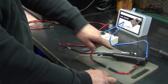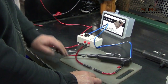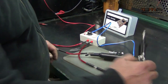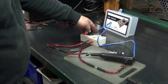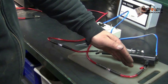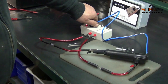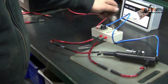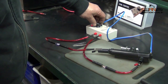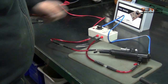So while we're still set up, I thought I'd better just try this coil with these two leads. These two leads have got about an inch and a quarter gap, and it didn't work on the old coil. It didn't have enough spark to jump through it, so that's why we use this. But I thought I'd better just try this one with these ones, and there you go. Twin spark. We've got a nice coloured spark there, and we've got a nice coloured spark there. Both of them running at the same time at low revs, and at high revs. That's well over 10,000 RPM. And we're done.